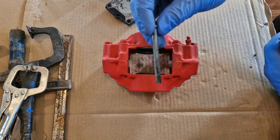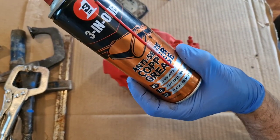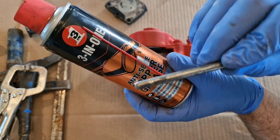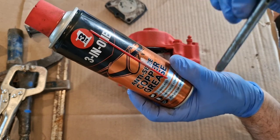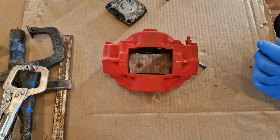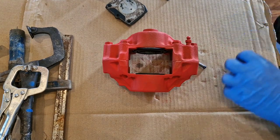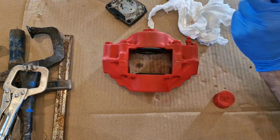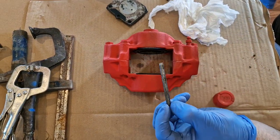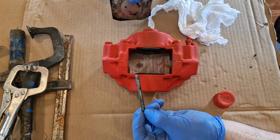These pins are fine — we've cleaned them up — but I'm going to use some copper anti-seize grease on them. The reason for that is there's a bit of temperature involved in here; we don't want ordinary grease in there spoiling everything. So I'm just going to give them a controlled spray of that.